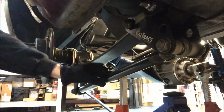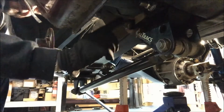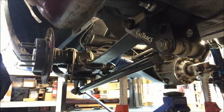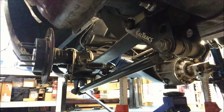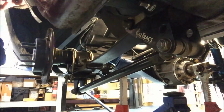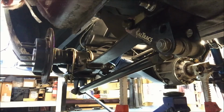In my case, I haven't tightened a turn. And that's something that you got to figure out on your own. They say the hardest hit is when these stops that are up here are just touching the spring, because that rear end's going to move whatever that air gap is, and that's going to give you a harder hit than if you already had preload on there. The preload could be one flat of a turn, it could be a whole turn. You're not going to get much more tightening this more than one turn. It doesn't do any better to tighten it up.